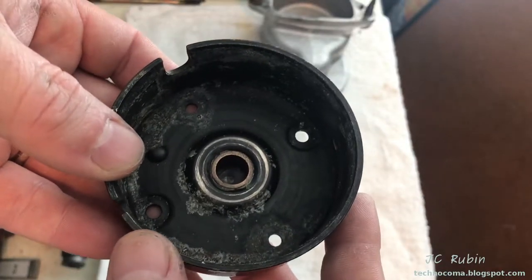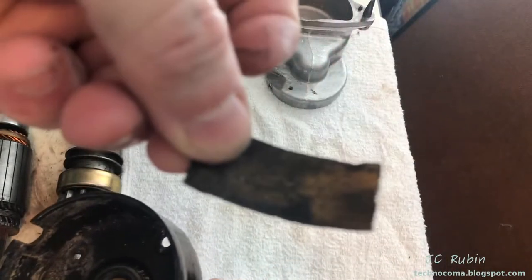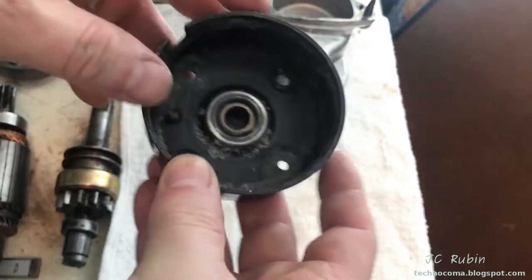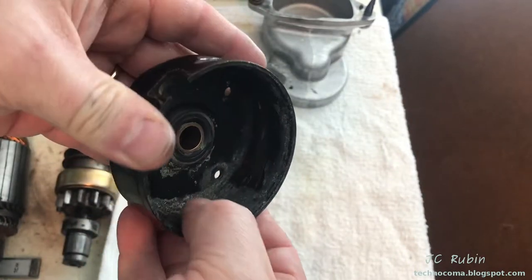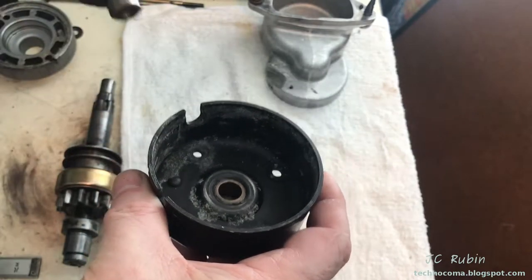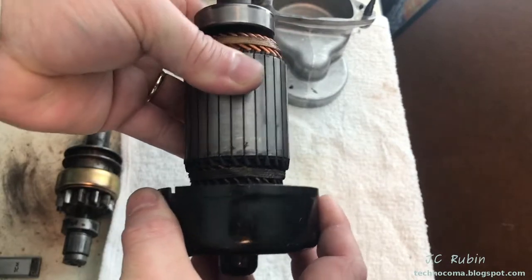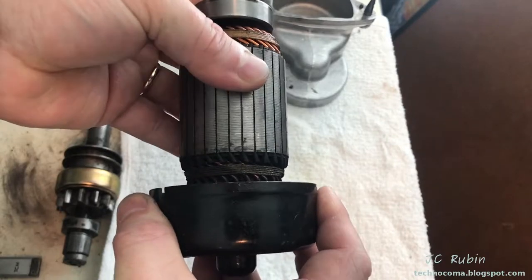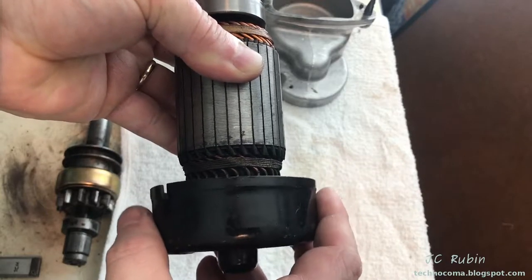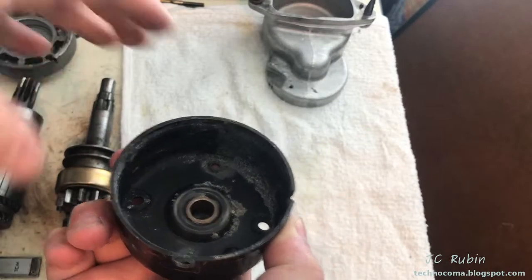Inside the now-cleaned cover, we can see the paint is eroded away and there's a silhouette of tape on both sides — I found one piece of that tape, so we'll probably put that back on once the cover is done. On the other side, this bushing is torn up. As I place this in, look how it wiggles — the whole thing flexes. I'm going to have to replace that bushing; it's no good. The cover itself goes on the finish table for now.